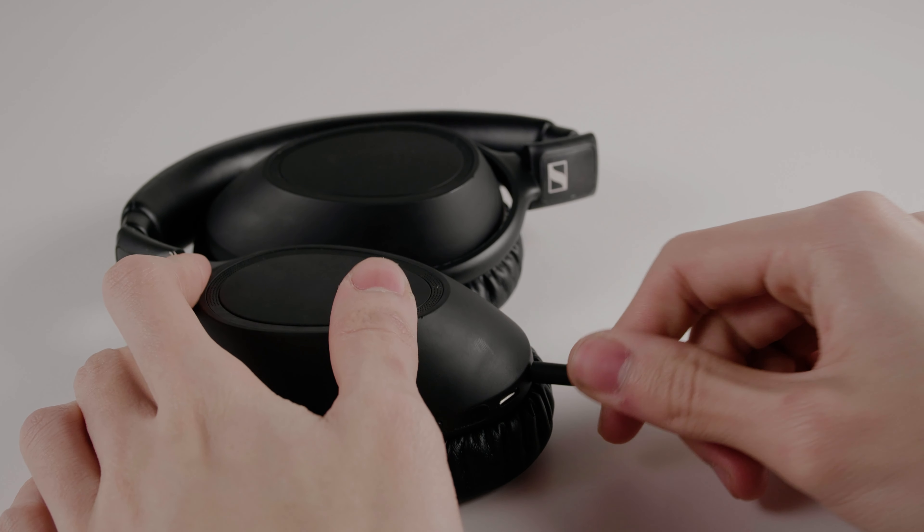There's a headphone jack here, but it's not a standard 3.5mm — it does come with a cable though, which is nice. The good thing is that even if the battery is completely dead, you can still use them wired, but you won't get noise cancellation. They do require a lot of gain — around 80 to 90% on your interface or headphone jack. Even on Bluetooth they require more gain than usual. When the battery is charged and you use them wired, it actually acts as a preamp — just make sure the volume is all the way up to take advantage of that so you don't have to drive your source device as hard.